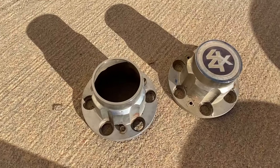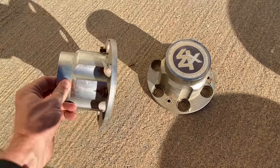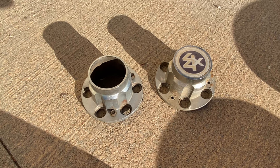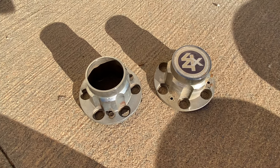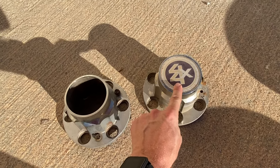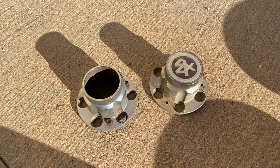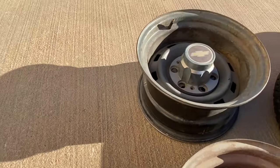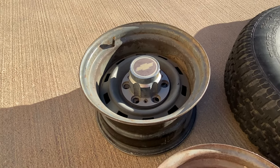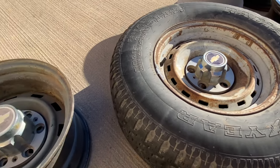If we take a closer look at the 6-lugs, these look similar to the 5-lugs but they had 6 holes. They were still metal and chrome, but they were quite a bit bigger than the 5-lugs. The reason being was all the 6-lug truck rallies were for 4-wheel drives, and all the 5-lugs were for 2-wheel drives — hence the 4x4 stickers. You would have had this center cap, or you would have had one with the center cut out, and that would have been for the 4-wheel drive hub. A lot of guys elect to take these old 6-lug rallies and put them on their 67-70 C10s because they'll fit, but a lot of them don't like how big the center cap is.